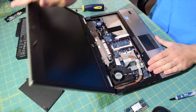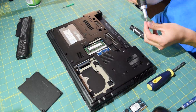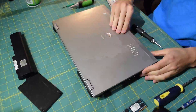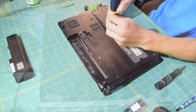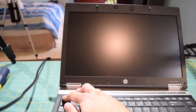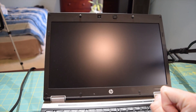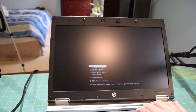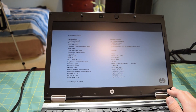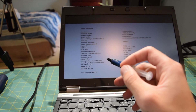So I just finished the upgrades and now I am writing a Windows 7 image to a USB flash drive. I was able to do everything I wanted to do to this PC. I threw a 4 gigabyte stick of RAM in here, taking the place of the 2 gigabyte stick that was originally in the slot under the keyboard, so we now have a total of 6 gigs of RAM. I also installed that 120 gigabyte SP550 solid state drive and replaced the thermal compound. I accidentally put way too much thermal compound on the CPU, but that Arctic MX4 came out a lot faster than I intended.